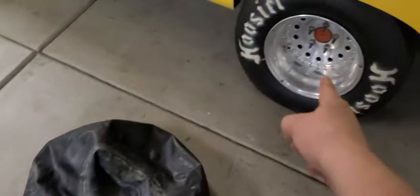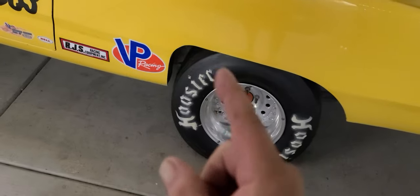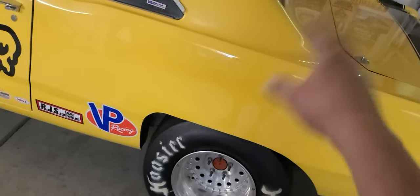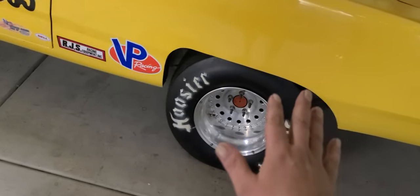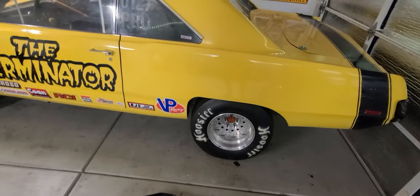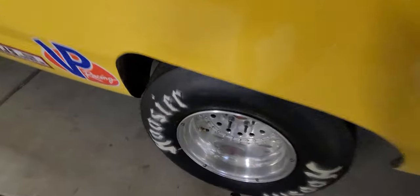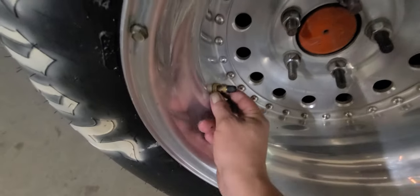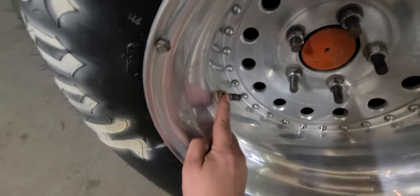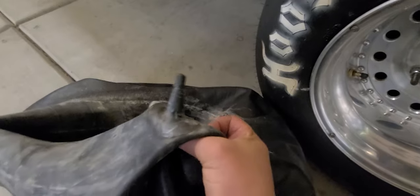I got the tires back. They had one tube — this tube was in that tire. There was no tube in the other side, and all they had was a valve stem. So there's a chance if I would have taken this to the track and hammered on it, that tire could have just went pop, or flown off, or ripped the valve stem. Just bad all around. My patience literally could have saved this car from smashing into the wall. I'm very glad that I took Project Nitrous Brian's advice and I'm going through this step by step. We now have the right valve stem with the nut on it to keep it in place. This is the old one — that's not going to be good for a 10-second car.